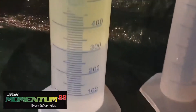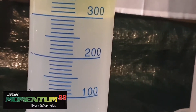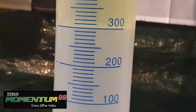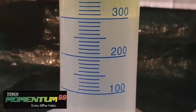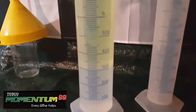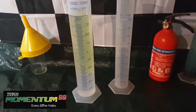It would appear no at first glance. A 300ml separation line means that no ethanol was absorbed into the water. If it were at 370ml the fuel is E10; at 335ml it's E5. To remain consistent with the testing method of past videos I'm going to leave this an hour just in case there's any change, and it gives me the opportunity to break with a 45-second advert.